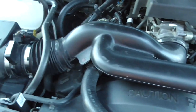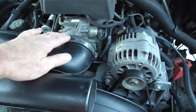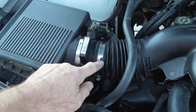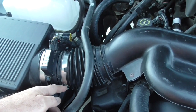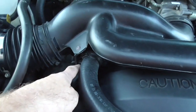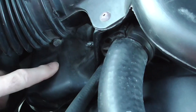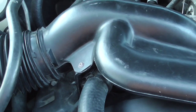The manual says to remove the air duct and the plenum. The way I normally do it is loosen this up and take it right off the throttle body intake — just unscrew this clamp here. On the airbox side where the air filter is, there are three clamps. The easiest one to remove is this one — it slips off and on the easiest. You also need to pull this little pin out so the air plenum and the resonator, which is this thing down here, comes out.